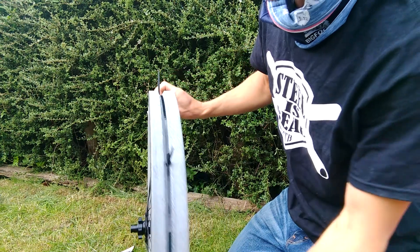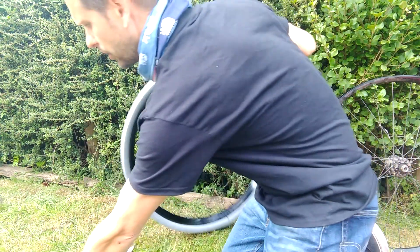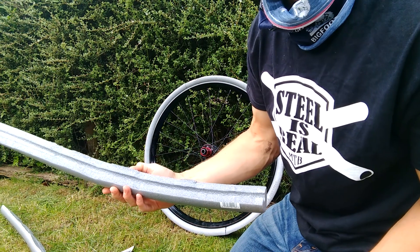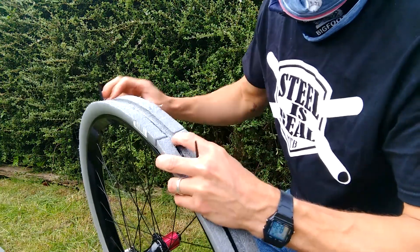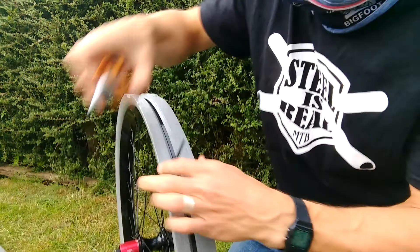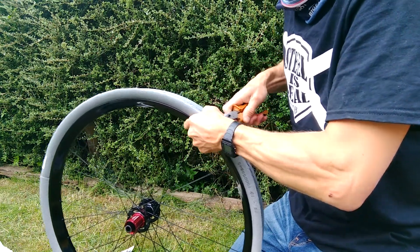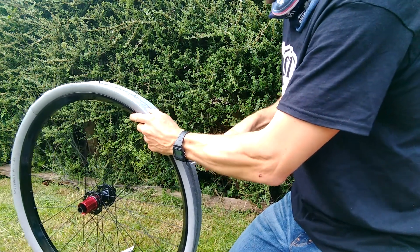So what I came up with is the idea of a steel band - but instead of steel, using zip ties. Buy the longest zip ties you can; in this case I got 370mm. A 50-pack cost me £3. The insulation costs £2 for a metre length, and a metre length will, if you cut it in half nicely, do one rim - 29er or 650B. You'll need six zip ties for a 650B. Just click them on a few times, wrap them around the inner channel, tighten them up and go round with a set of pliers. Try and do them fairly evenly so you get an even tension all the way around.